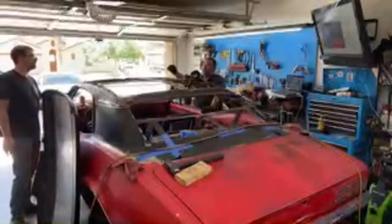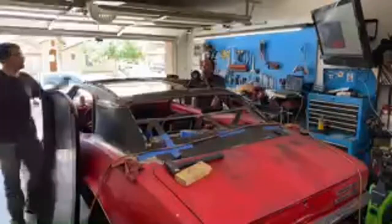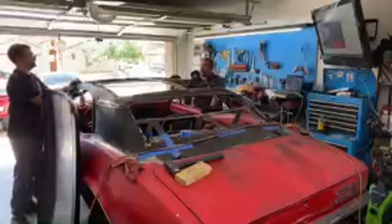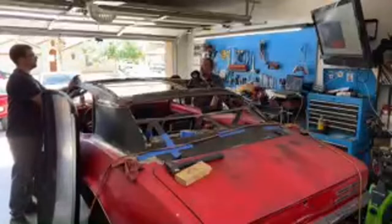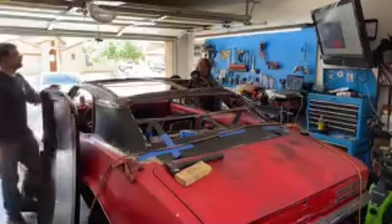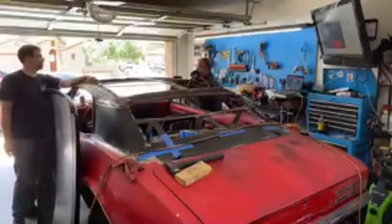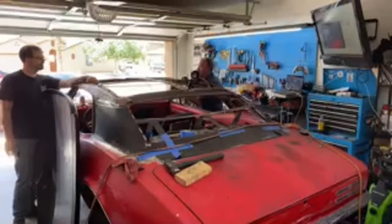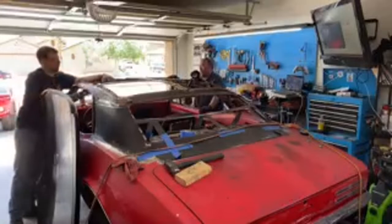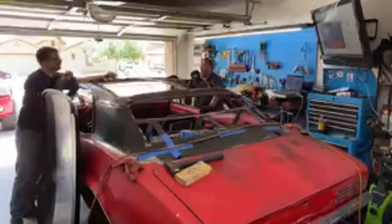But you did say these had to be in a special order. Yeah, don't mix them up. Just like 1, 2, 3, 4, 5. Leave them in the same spot or tag or label them. And there's different holes in the body here. Try to put them back in the same holes normally. It's been the rule of thumb, but they don't say that. There's no rubber piece that goes on the ends of these. And I see Porsche has a special $20 rubber boot that you put on the end of the rod. It locks into place, and once it's snapped in, clock it to the 12 o'clock spot and it doesn't move. I don't want to mix up the order of them, but it's just got the weird hook on the end that kind of hooks in.